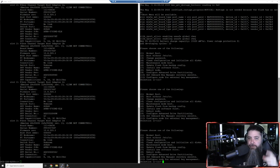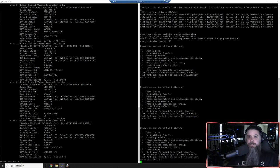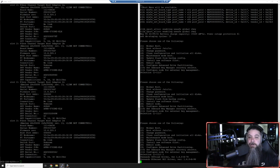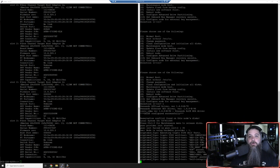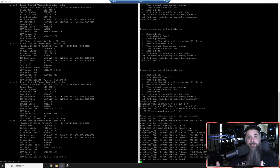For this one, we're going to boot straight into ONTAP because I know there's nothing on it right now - just the old version. It's a completely fresh install. We're going to let this thing boot up completely because we need to get to the cluster prompt in order to update the service processor. Once we do that, we don't have to console in anymore over a cable - we can SSH into the system once we assign it an IP address.